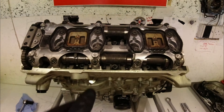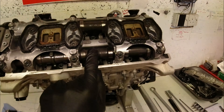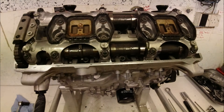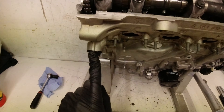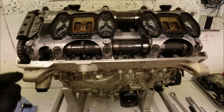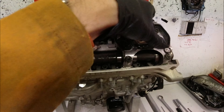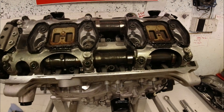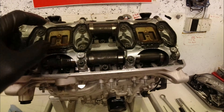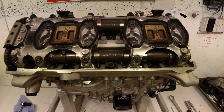The first job is to take the camshaft out of the engine. I'm going to put it back to top dead centre, then take the cam chain tensioner off — which on the front of this engine sits here. That removes all the tension off the cam chain, and then bit by bit I'll undo these cap bolts that hold the cams in and slowly, stage by stage doing opposites, raise those up and take the cam covers off.